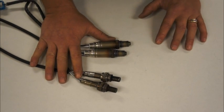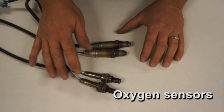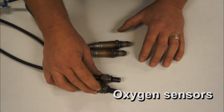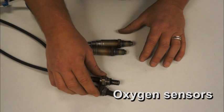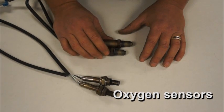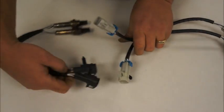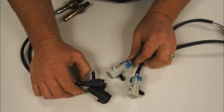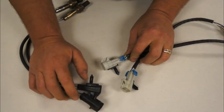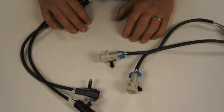These sensors here are O2 sensors. Basically they measure the air-fuel ratio coming out of the exhaust system. These are going to be mounted in your exhaust and are going to be critical depending on what computer system you have. We'll make sure when you order the engine controller that you have the right one. On the sensors, you're going to have two different style connectors — black or gray — and this is going to help determine what sensor is going to be right for your application. Not all computer systems are going to run the O2 sensors, but if it is necessary, it's a big part of how the engine's going to run right for you.